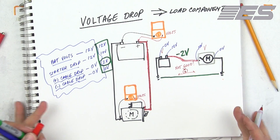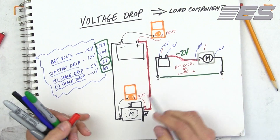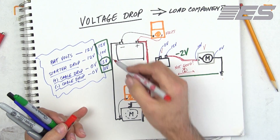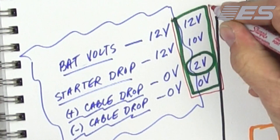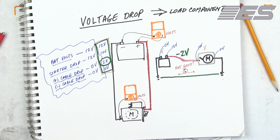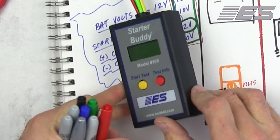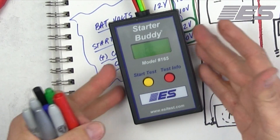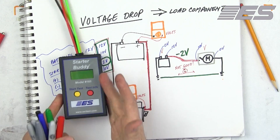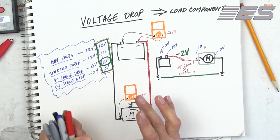There's no magic to this tool. It's simply taking voltages — which you can get with a voltmeter — and taking the voltage drop across the starter and subtracting those numbers to come up with a real-time operational decision based on a very simple concept. This is a great tool for field service. We didn't put a lot of money into a fancy case. If you need it to be waterproof, put a Ziploc bag around it. We're keeping it inexpensive — it's not $1,200 like some people want you to spend.